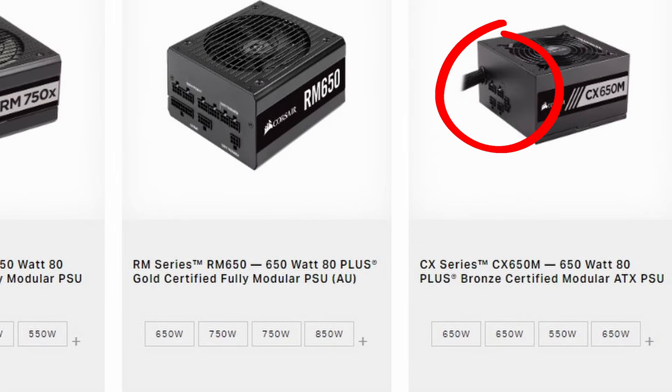Over here, you can see this particular one comes with a built-in motherboard power supply, and then there are some modular cables here. If you're going to build your own computer and put in a pretty new hefty graphics card that has a lot of power draw, you might want to consider a power supply that can bring you three cables. Some power supplies, especially the lower wattage ones, won't have enough cables because you'll need them for other parts of the motherboard and computer.